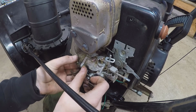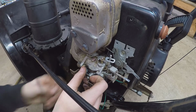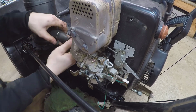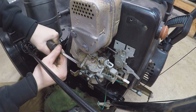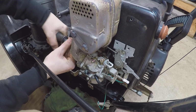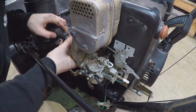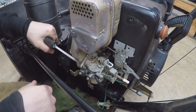That's not fun when that happens, especially when you have everything on, like all the shrouds, and it's just boom. No air. Like medium snug on them. That idle, that RPM hunt could also be an intake leak. So if this gasket was leaking, it could be that too. Unmetered air entering.